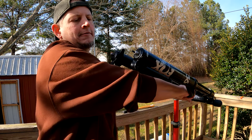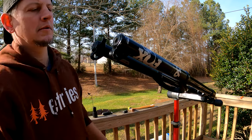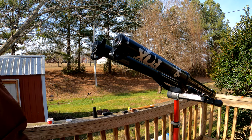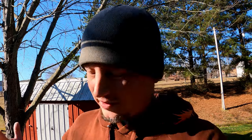Slide the lowers up now, but not quite all the way. The holes in the bottom of the lowers is where you're going to inject fresh oil. Now it's time to add the fork oil. Like many of you, I have an OEM fork, Fox Performance, obviously, that I'm doing this service on. But my fork says Fit Grip.